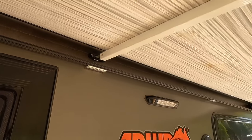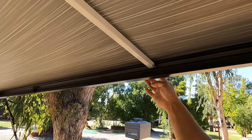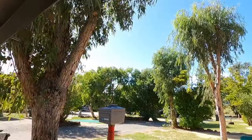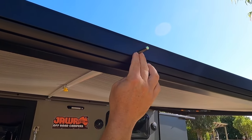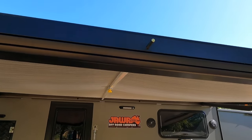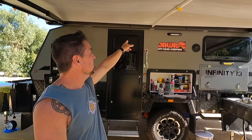We drilled a new attachment for it to hook up at the awning end. Some people aren't going to like this, but I've just drilled through the fascia of the box awning so it's nice and stable. You could also run a peg back to the ground and give it a third leg. For a $35 investment and a few minutes drilling — I think it was an 8.5 mil drill bit — it fits in there really nice and snug. Set them up when you're at camp because you never know when you're going to get a freak storm.